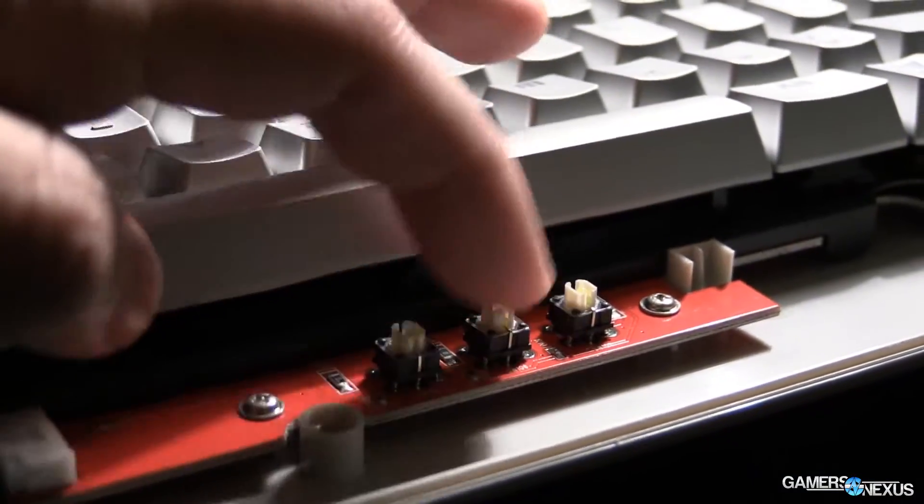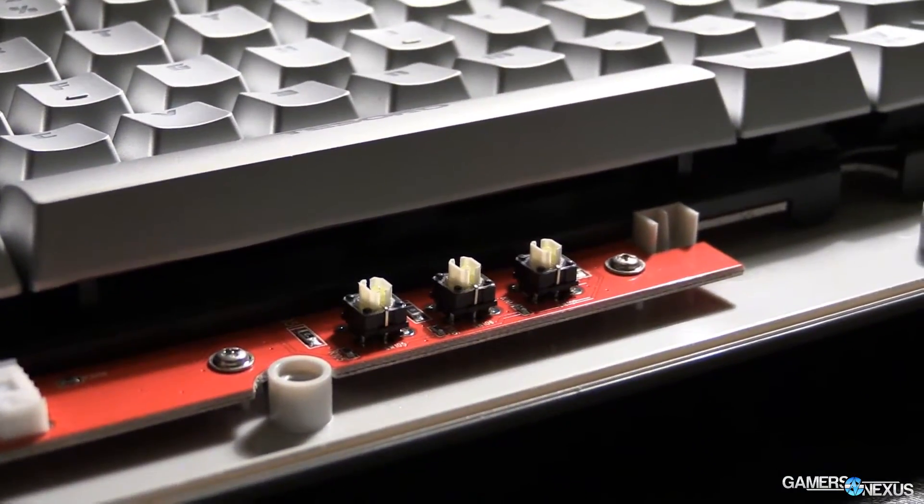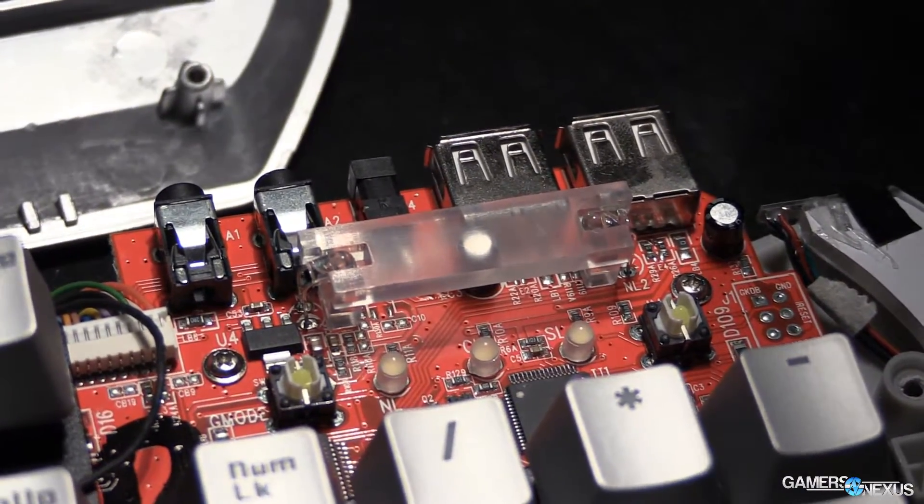A PCB will flex when you do that, and for a lot of users that's potentially an undesirable effect. Because when you're typing — especially if you're typing a lot, heavily, or loudly — you really don't want the board flexing around under your fingers as you push down. Some users like that; I've definitely seen forum posts where people prefer the flexing nature of PCB backplates. For metal, we get this resilient, thick piece of metal that really doesn't move when you type, and it provides more of a resounding clack — a very resolute press when you push the key down. For a lot of users, that resonating quality feels more sturdy or more solid, and that's definitely true to the extent that steel is far more solid than plastic.